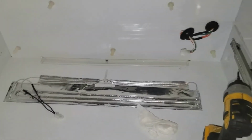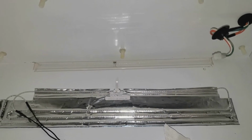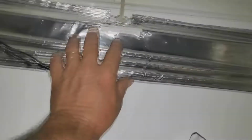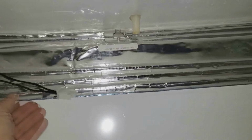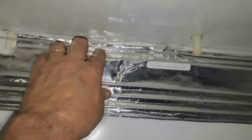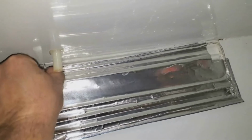If you're going by the instruction booklet that comes with this, I would definitely reverse two of the items on there. They tell you to put this bead of silicone along the back wall, around the trough, and along the back wall. Then they tell you to preform this drain in place. And when you do preform this drain, I suggest sticking this in to make sure that it goes all the way in for you, so that once you take the sticker off of this, you're not fighting with this right here. But anyhow, you're going to preform this by bending it along here, figuring out exactly where you're going to place it. And then the idea is to take it back out and peel the sticker off.